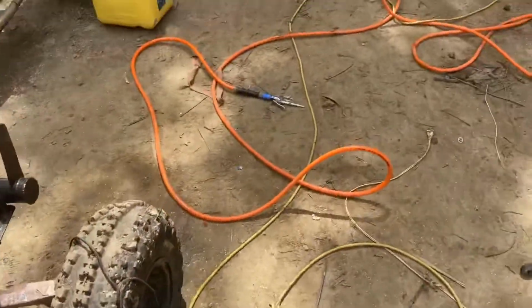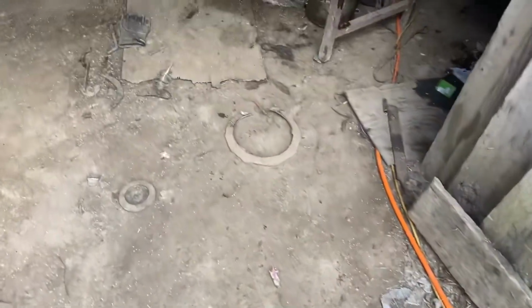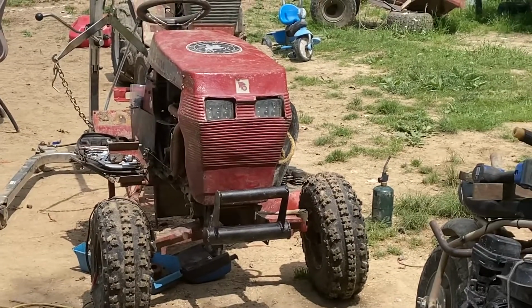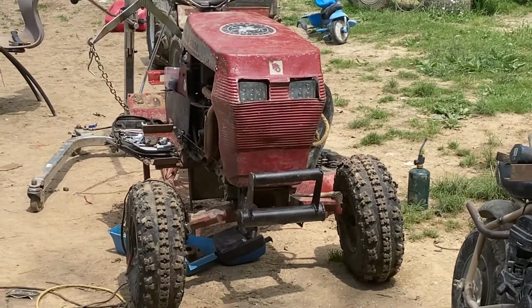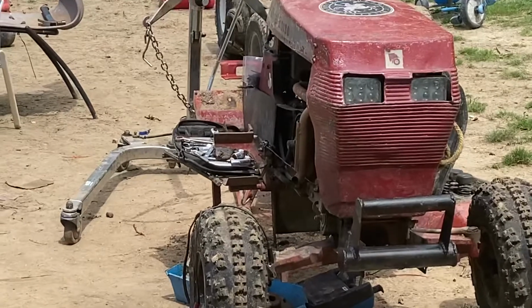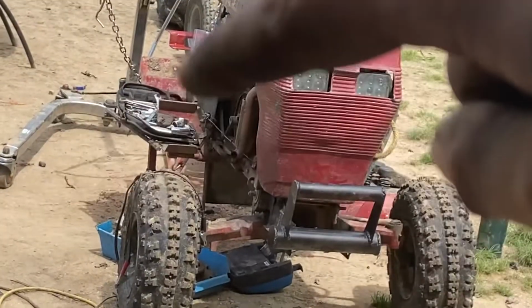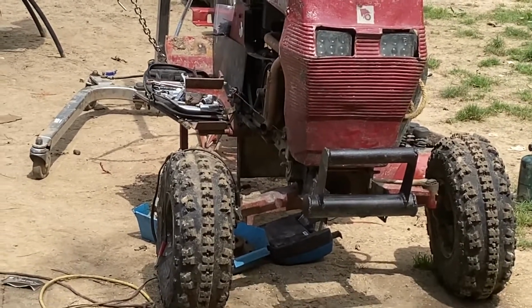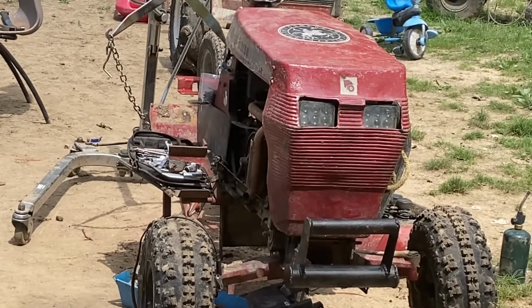Sleepy's 8-speed had some crunching sound in it when I was pulling my wife back home. And I was just thinking, okay, I know 8-speeds are pretty loud. They whine, they cry, they make a lot of noise, but they're not supposed to crunch. So I got home, it was slinging oil from the back of the trans all the way up around the belt. It was slipping horribly. I knew that wasn't good. So yeah, let's take a little look at Sleepy's 8-speed.